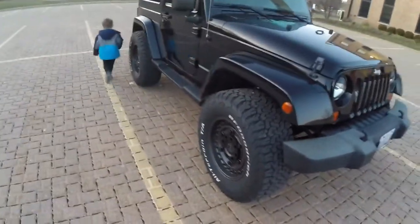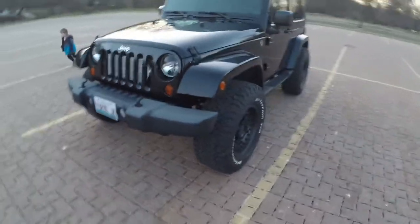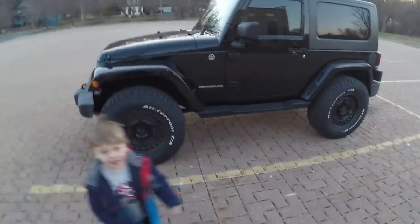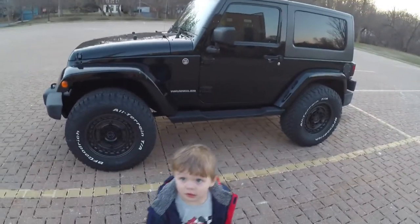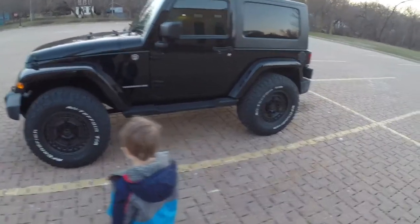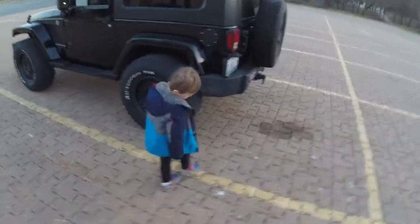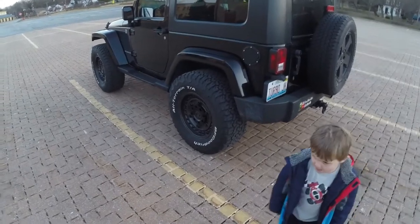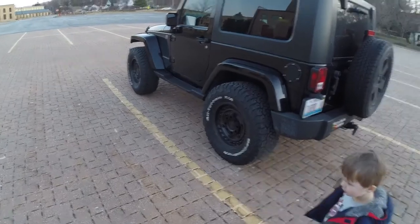These wheels and tires are definitely super heavy, and when I'm driving they rattle the Jeep. I'm basically on stock suspension with the leveling kit, and they're brutal. I do have a new lift kit in the garage — it'll be in my next video. I got the triple rate springs, getting rid of the leveling kit, going with new shocks that are going to take care of a lot of the rattling. It should sit a little bit taller, and I won't be rubbing up front once I deal with the air dam situation.